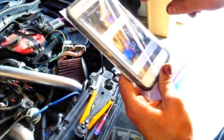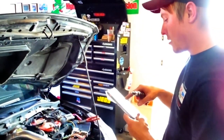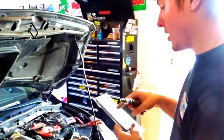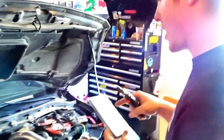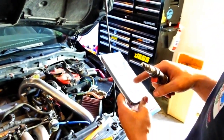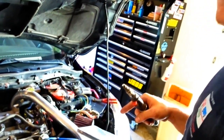Red/black wire, meaning indicating red wire, colored red wire? No, red wire with a black stripe. Yeah. Strip the ends of the wire and slide two pieces of provided heat shrink tubing over the wires. That's all it says. It does not say to terminate either of those wires. And then it goes to connect the 16 gauge orange wire, which took the place of the black 16 gauge wire. It just did not make sense at all.